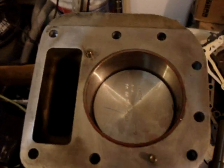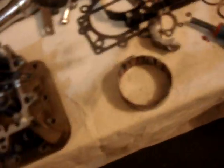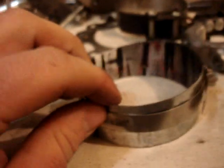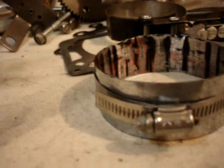Here I have the piston back into the cylinder with the connecting rod attached. As you can see, it's poking out through the case there. There's a little arrow and a notch on this piston that has to point to the flywheel end, which is this end of the motor here with the stator — this is where the ignition module goes. So I have that in correctly. I used this homemade ring compression tool, which is nothing more than just a piece of sheet metal from a piece of duct work and a hose clamp here. It worked really nice.